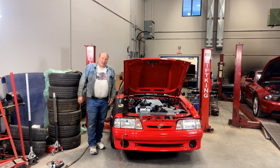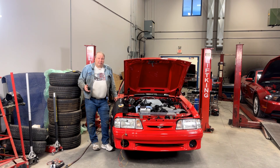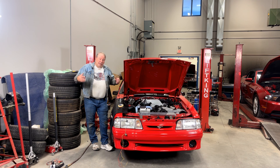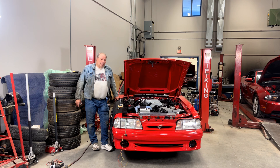There are lots of reasons why you might want to do this. The most notable is that you want to increase the electrical range of the mass air meter. A standard 2005 to 2010 slot MAF is electrically compatible with the Foxbody, but its electrical range is quite a bit more than the stock meter, and if you put it in a big housing its electrical range increases substantially. By electrical range I mean the mass of air that can go through the meter before it hits five volts — five volts being the signal limit from the meter and the limit the PCM can recognize.